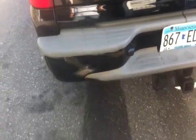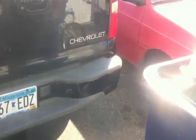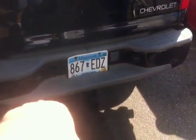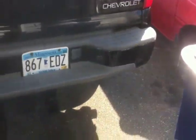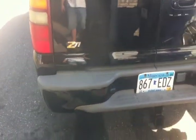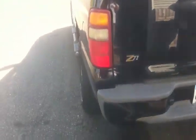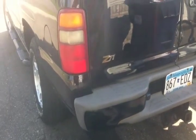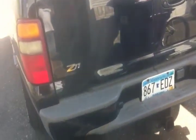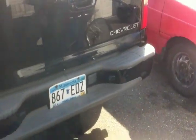And then I single staged the back just now before I pulled it out. So I had to tape off all the gray plastics, the license plate covers, everything. And I single staged this through the middle here. I hit it with the wire wheel, knock off some of the rust, and then I hit around those areas with 400 just to take some of the heavy scratches out, and then just hit it with some single stage just to make it look better.